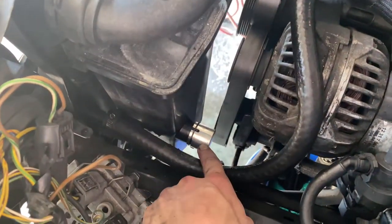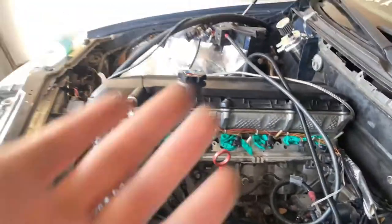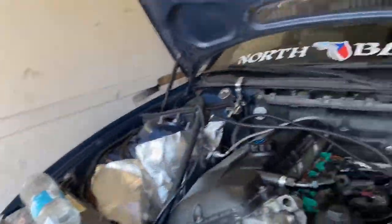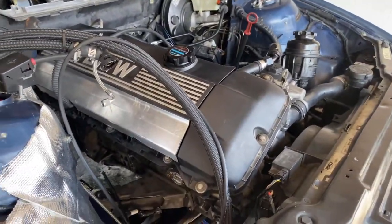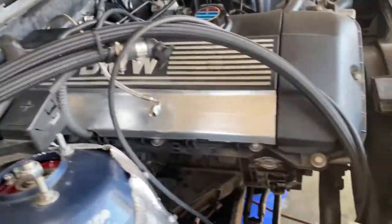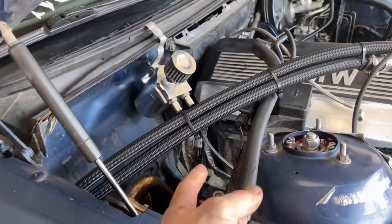The kit comes with a cool little cap-off here and another cap-off there. You've also got a 1/8 MPT port right here if you want to run a water temp sensor or something like that. I'm just going to leave it capped off for now because I can see water temp on the computer via live data logging. Next, we're going to get the wastegate kind of mounted up, fit the header in here, and make sure the wastegate clears — I think it's a little bigger than the eBay one we had.